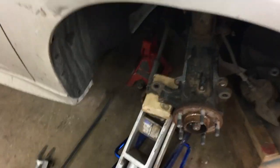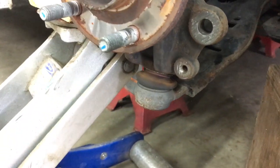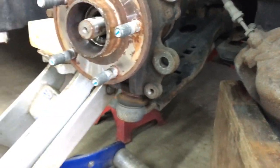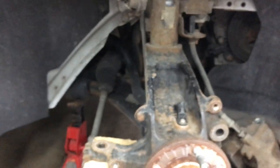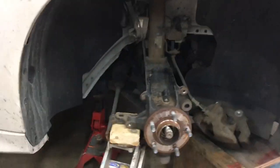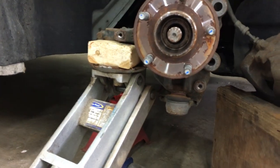New idea. I was able to kind of pop out the lower ball joint, but it would just spring back in — I could only get it to move a couple millimeters. I think that's because there's so much tension on the lower control arm, mainly because they're bushings, not sphericals that will spin freely. Bushings have tension built in. So now I'm compressing the suspension up a little bit with a jack on the knuckle to try to pop it out.